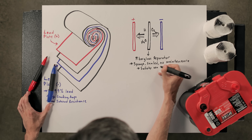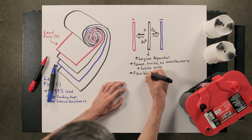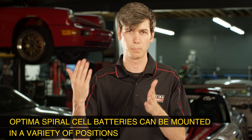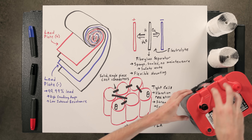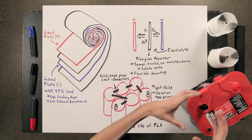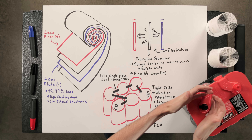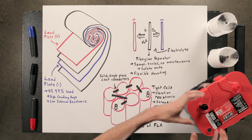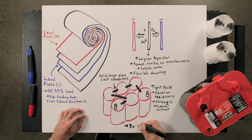For safety, there are vents on it so if you overcharge it or if pressure builds up from heat, there is a way for pressure to escape. The fiberglass sponge-like divider also gives you flexibility in mounting — you don't have to worry about spills from the battery being at an angle. The cylindrical case provides uniform compression around the cell, aiding vibration resistance and keeping the cell intact as it expands and contracts. Johnson Controls, Optima's parent company, has found in internal testing that these batteries can last three times as long based on the design and construction changes.